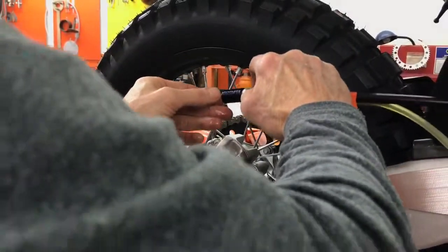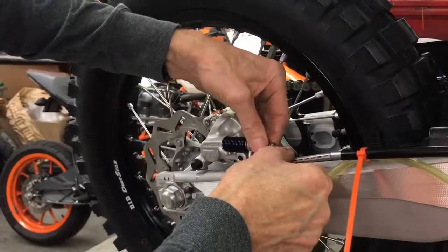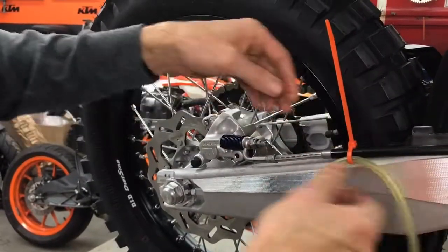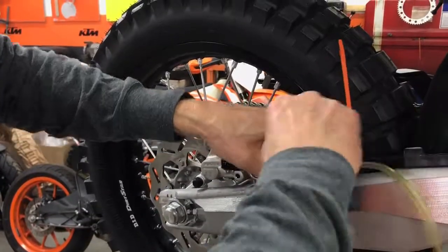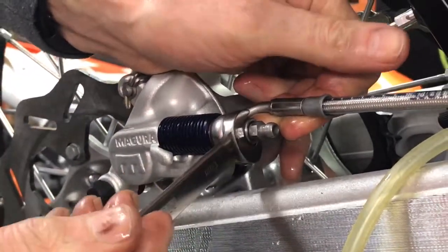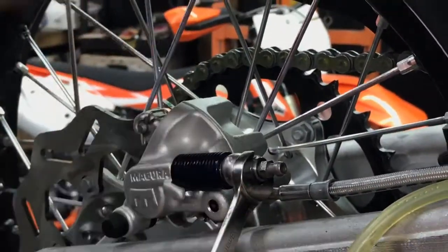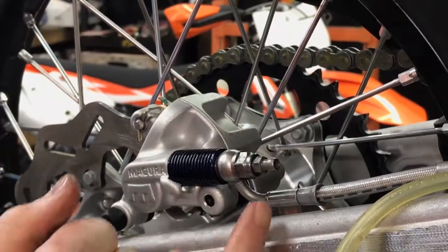Okay. You've removed the cable from the holder here on the swing arm, so the brake line's very free, so it'll work with you. Just thread that guy in there. Okay, we've got this kind of thing. Now I'm going to ask you guys to sort of counter rotate this brake line like this, about a third of a turn, a third of a rotation, and then you just take your 13 and snug it up. Maybe a little less, 5/8 of a turn. There you go. And now tighten it so that that brake line, just let it come around so that it finishes something like that. Better to have it back here than rotating this way in harm's way.